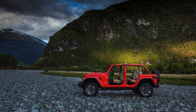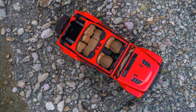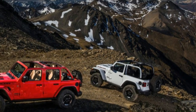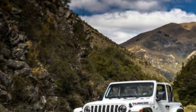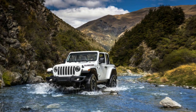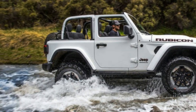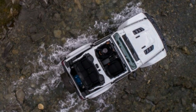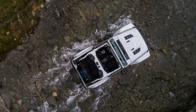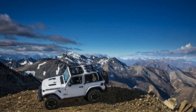There's an all-new manual transmission available only on the V6 model. This new D478 gearbox is still a 6-speed but has a deeper 5.13:1 first gear ratio. That means a manual Rubicon with 4.10:1 axle gears will have a crawl ratio of 84:1. The new 8-speed automatic also has a deeper first gear than the old 5-speed automatic, giving auto-equipped Wrangler Rubicons a crawl ratio of 77.2:1. Those are impressive numbers, meaning the JL can crawl more slowly than virtually any other 4x4 and have the proper gearing to turn larger-than-stock tires straight off the showroom floor.